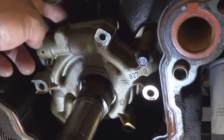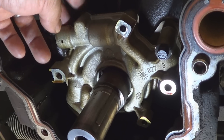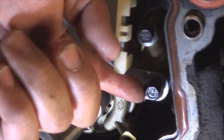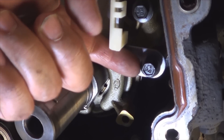This is your chance. The oil pressure in this Durango was good and it doesn't have high mileage, so I'm going to go ahead and leave it. Install the new tensioner and tighten the bolts to 250 inch-pounds — and don't get it wrong, they're not foot-pounds, they're inch-pounds, otherwise you'll snap these bolts.